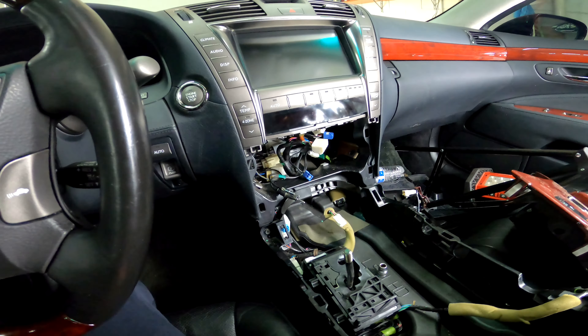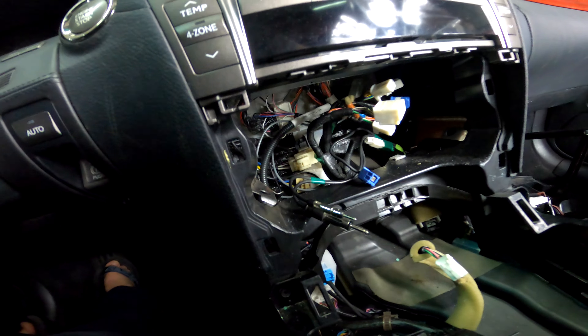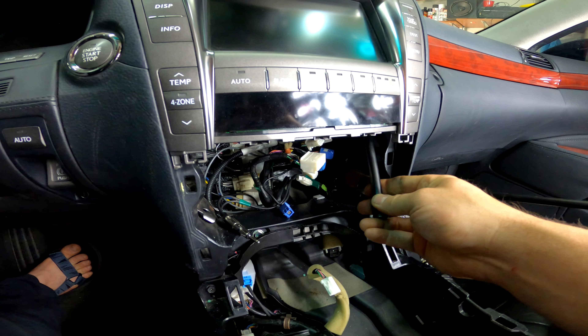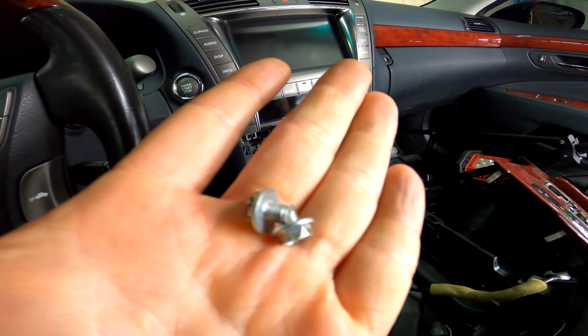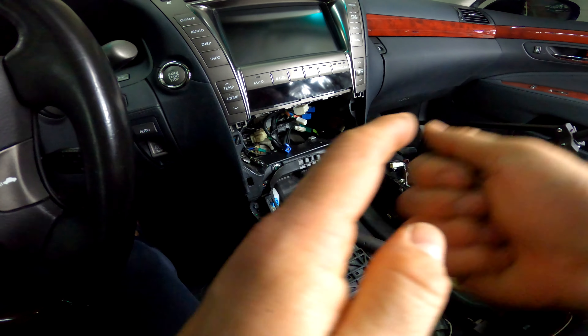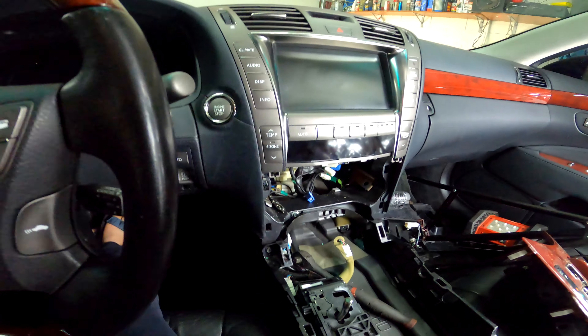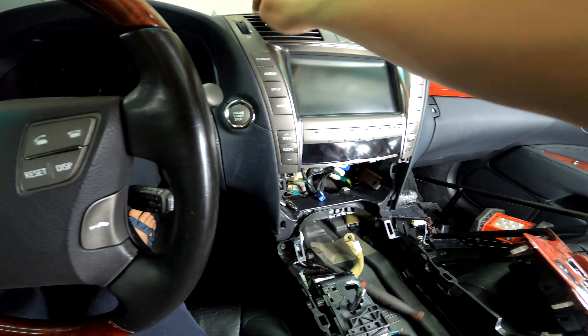Now here's where you'll need that 8-millimeter again. There are two screws — one on the far left and one on the far right, way up in there. Find those screws and remove them; they're very small and 8-millimeter or Phillips. These two screws are the only two holding this entire assembly in. Be careful because the top vents and top trim are very fragile and brittle over the years, so don't pry up there or it will break and crumble.